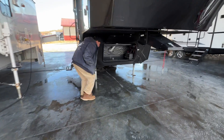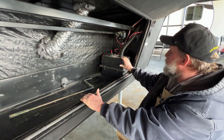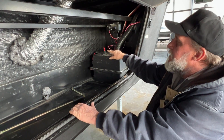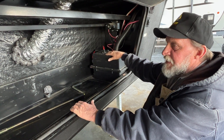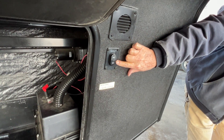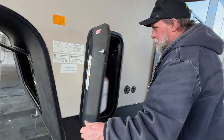Going to the front compartment: it has a manual crank handle for the two front jacks. It's got one 12-volt battery on the unit, and also has a battery disconnect on the top of the battery box. If you don't want the trailer draining the 12-volt juice out of the battery, you can turn the key at the top off and pull it out — it'll save all the 12-volt that's in the battery. It does have a vent on the side for the battery, and we have our up and down button for the front jacks to take it on and off the vehicle.